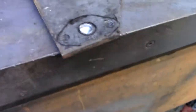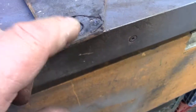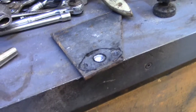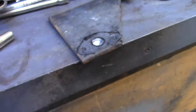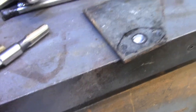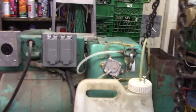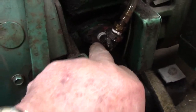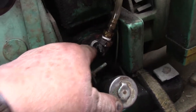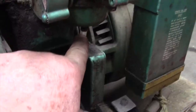So I traced the gasket shape, cut the piece, and tapped and threaded it. Once that's done, we'll mount it on the motor. Here's my contraption: I made a blanking plate, tapped it, put a street elbow on it, then a fitting, and that's the pipe that goes over to the vacuum fuel pump. So I'm picking up the vacuum from the base of the engine.